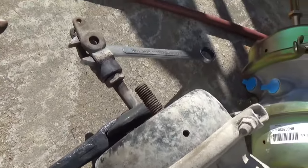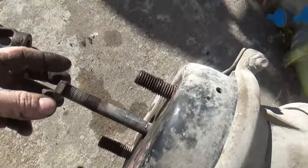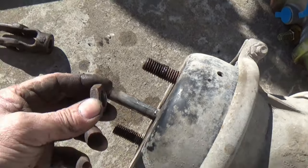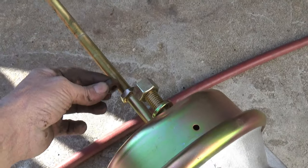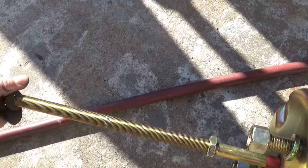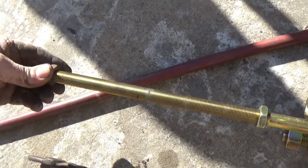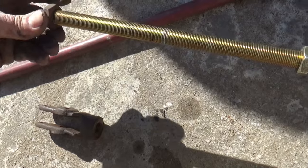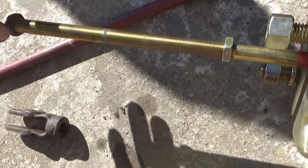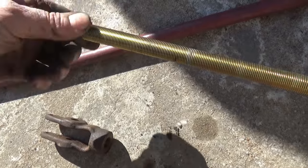Holding it with a pipe wrench and using another wrench inside the clevis, we got that all off of there. Now it's cooled down — I put it in water. I'm going to take this old nut off and thread it all the way down to this one. The reason I'm using the old nut is to clean the threads off once I cut this rod off. If it screws up, I might damage the nut, so I'd rather keep the new nut clean and fresh and use the old nut to clean off the threads.